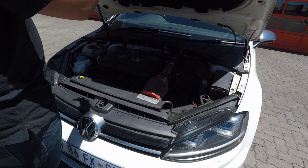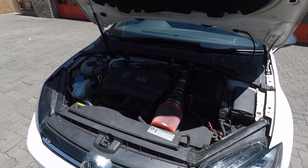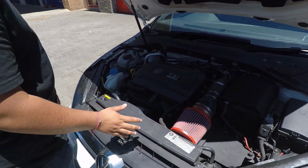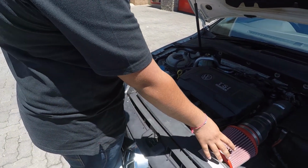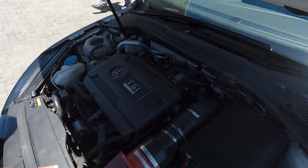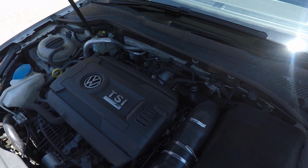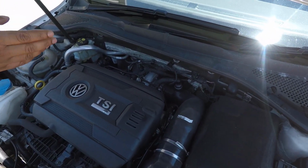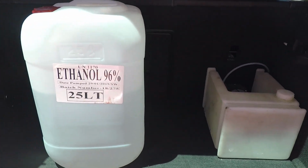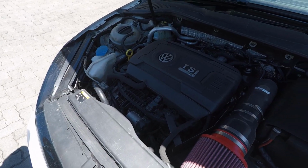Okay. Cool. So let's go check out the performance mods now. Looks a bit deceiving here. Everything looks quite standard, but what we have going on, first thing you can see is the intake with the Turbotechnics silicone. We've got a Turbotechnics V5 hybrid running there. That's what makes it a stage 3. Turbo back exhaust, so from the turbo all the way to the back, 76 mil. We've got a water meth system, and we're also running our Ultimate Performance bolt-on intercooler.